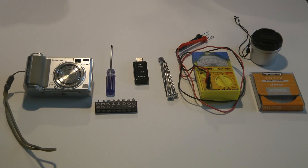This is very important to do. Even if you have the batteries out of the camera, there's a high amount of charge in that capacitor and you don't want to touch it — which I've done before. Not fun. The final piece is on the right: a conversion tube to allow us to use the infrared filter. I purchased the tube on Amazon; it's also available on eBay, as well as the filters. I'm using a 760 filter for this project.